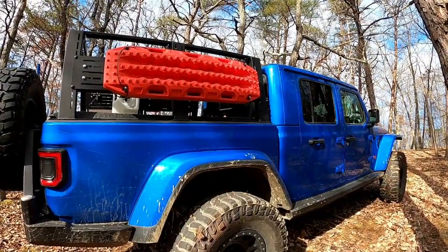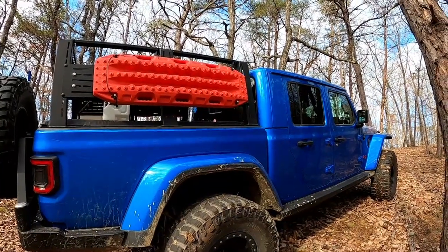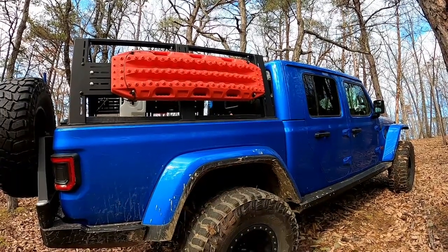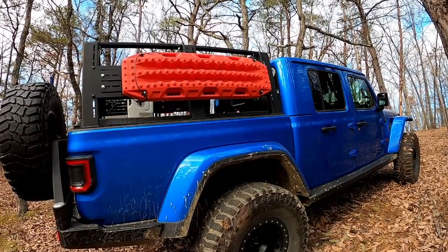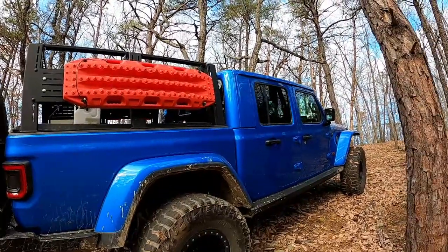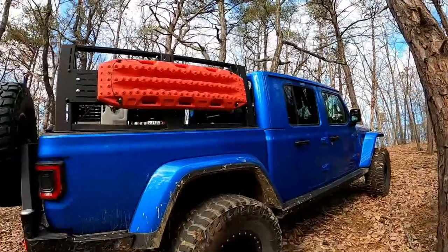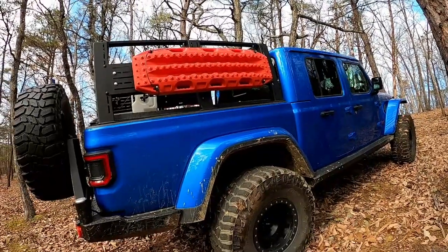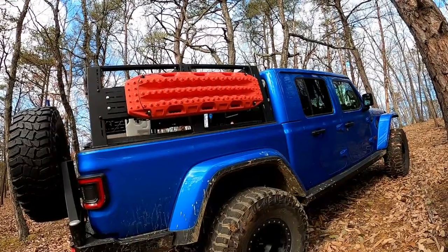So I talked to my 4-wheel drive shop, and I wanted to take it in. I got the 488 gears put on this thing, and I also got the underbelly skid. And I said, hey guys, I need you to help me out here, do something about this spring compression. I don't want to just put spacers in because my spring's compressed to the point where it's going to create an issue. So they came up with a scheme. I've got 3.5-inch Metalcloak springs, front and rear. They left the front alone. They took out the rears and they put in a 4.5-inch Evo plush ride spring with a 1.5-inch Terraflex spacer. And now it looks a lot better.